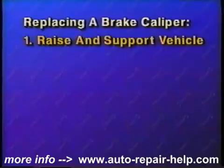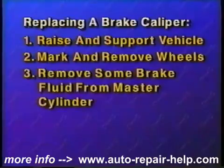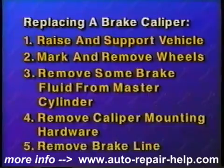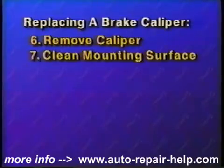Let's recap replacing a brake caliper. First, raise and safely support the vehicle. Mark the wheel's position, then remove it. Remove some of the brake fluid from the master cylinder. Remove the caliper mounting hardware. Remove the brake line and sealing washers. Remove the caliper. Clean the caliper mounting surfaces.